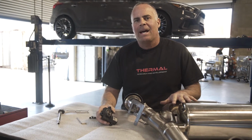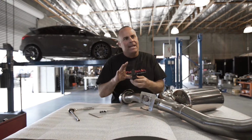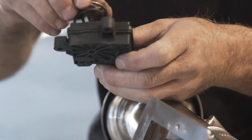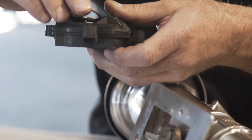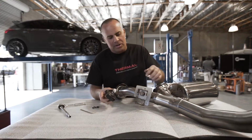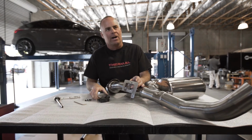For the fourth piece back, we have to install the OEM actuator. So you need to maintain the actuator and the spring assembly that's on it. Now and then you'll have to pop the spring assembly off of the actuator and clock it 180 degrees, and you'll recognize that as you're installing it. The worm-shaped bends of the actuator spring will slide into the carving of the actuator knob.